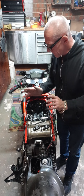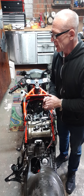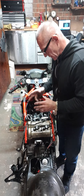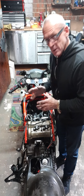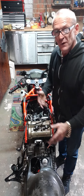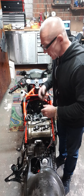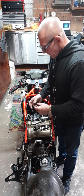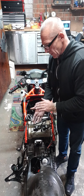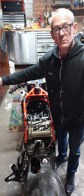Beautiful. Now, getting back to the fuel, it's got to come back at a certain pressure, so that was pretty critical. So I had to look at this spring, because you've got to keep a certain pressure in the line. If it's going too fast it'll starve, otherwise you're just going to pop it off again, so it's going to piss out the injector when it's open. I know where this sits, how far that goes, and I've got the ball bearing too, so when I unplug it, no fuel leaks, no pop off.